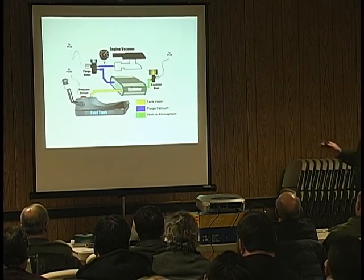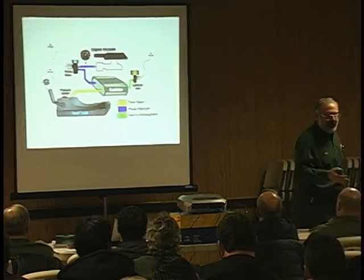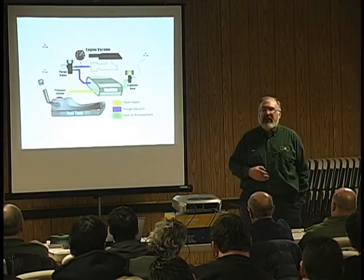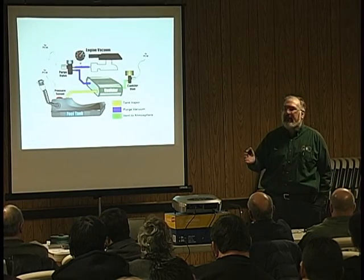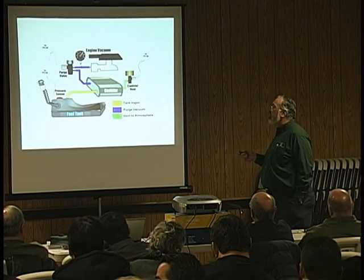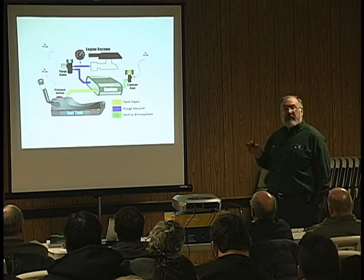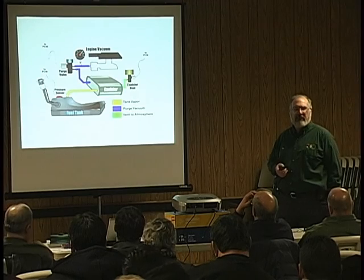You're going on a drive cycle, and sometimes you can drive 10 miles, sometimes you go 200 miles. You never seem to be able to figure out when it decides, especially an EVAP test, which has a lot of parameters that the computer must see. You've got to be at the right temperature, you've got to have the right amount of gas in it. There's a whole bunch of parameters. So this test to see if the system is any good doesn't happen very often, so this canister vent doesn't get opened and closed that often. So here we have a leak. I usually like to check this canister right away.